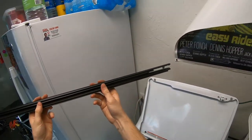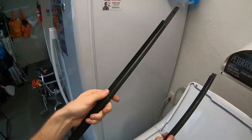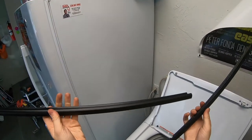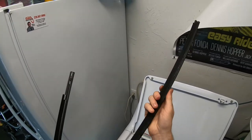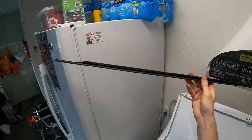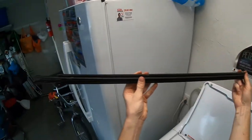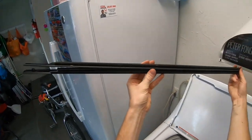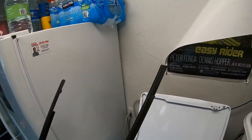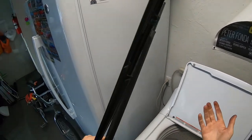I'm going to show you a side-by-side comparison of the new belt weather stripping versus the old one. The new one is clean, straight as an arrow, and should seal better. The old one is pretty dirty and gunky, but more importantly it is bowed — it's not straight — and that will cause improper sealing on the window.